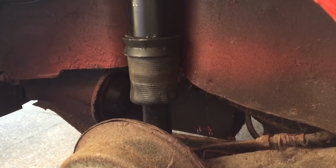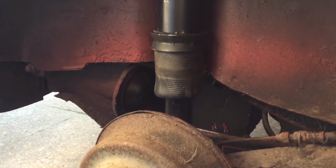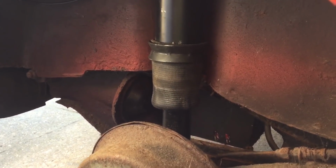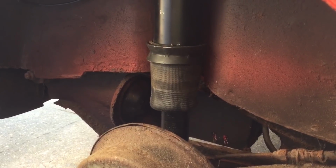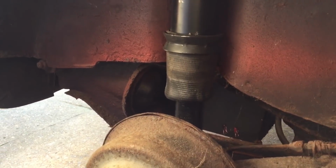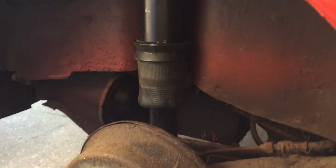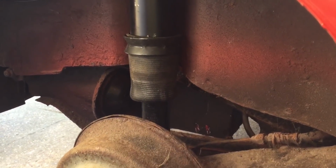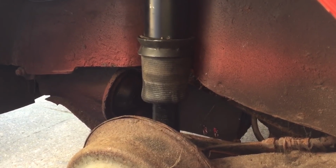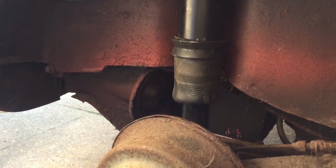And yeah, it's not stupid PSI we're dealing with here. We're only dealing with 100, 150 PSI. We're not in the thousands. So I'm wondering, get a real heavy duty marine type Jubilee clip. That must be out there. A stainless steel type thing, so it's a very thin strap all the way around. But obviously it's got a ratchet to it, sort of thing, nut and bolt, and so we can do that up tight. I think that could be an option. So we'll have a look at those and may replace them.